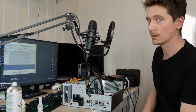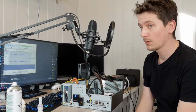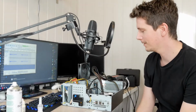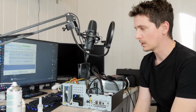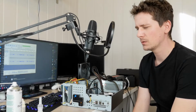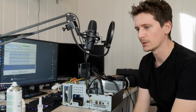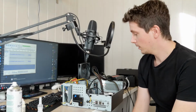And still nothing. So the only thing I've got left is to take everything apart, because this heatsink makes me have to unscrew the motherboard from the case in order to take it off and check the CPU itself, like see if there are any bent pins or something ridiculous like that before I can even go further.